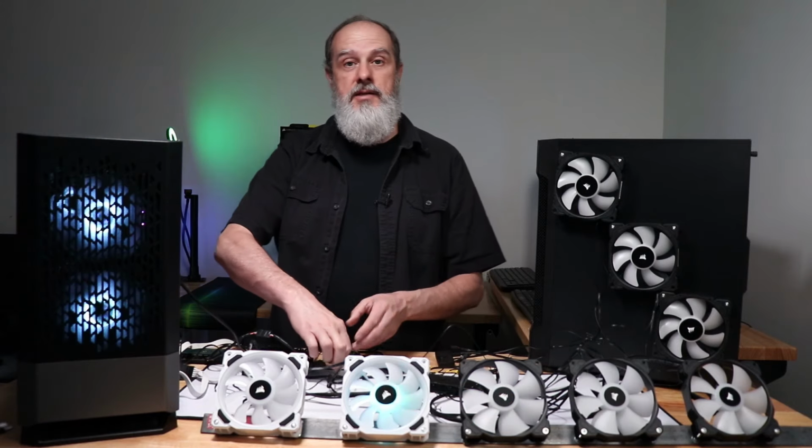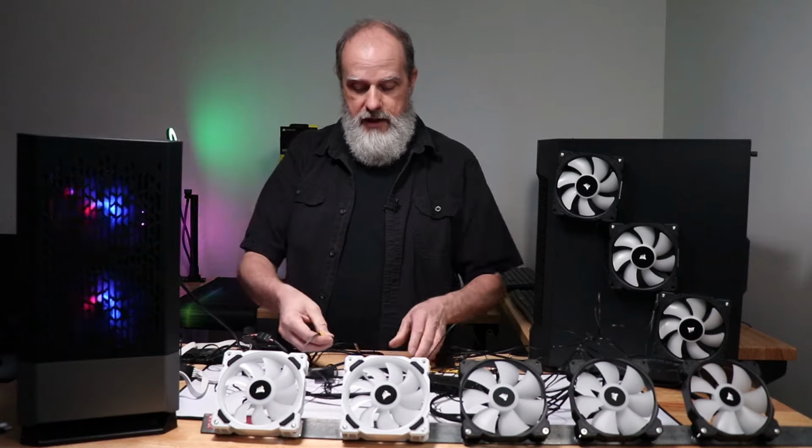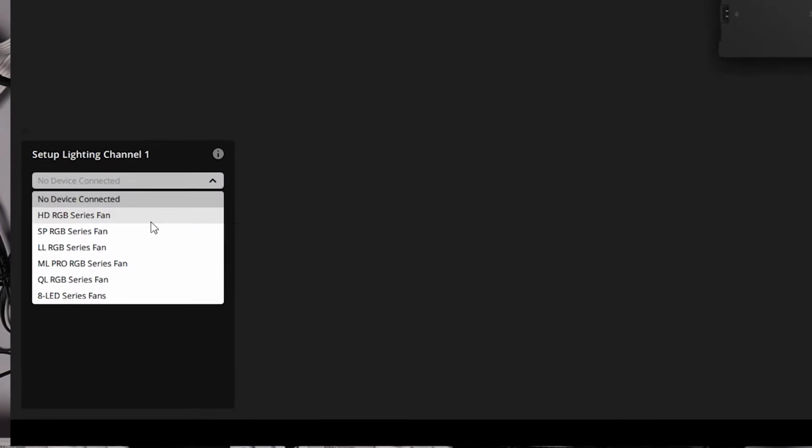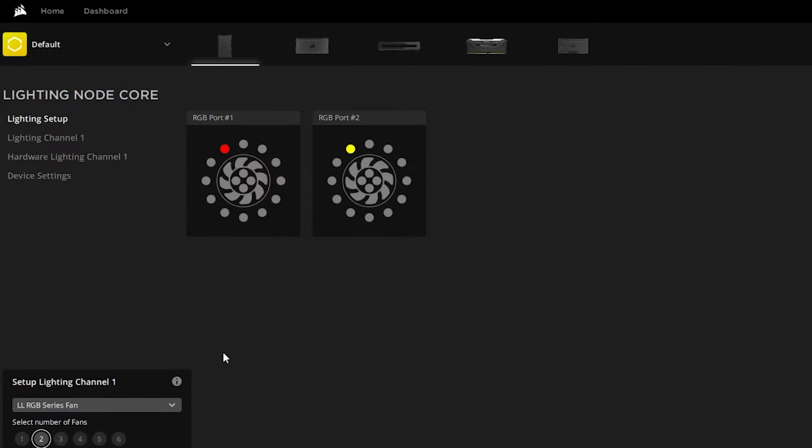So let's go ahead and take these same LL120 fans, and we'll plug them in over here. Port 1, port 2. And we'll go ahead and tell it. You have to tell it which fans you got. LL RGB. We've got 2 fans, and we'll go ahead and make sure they're in order. We've got the yellow one first. We need to rearrange those.